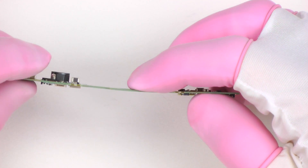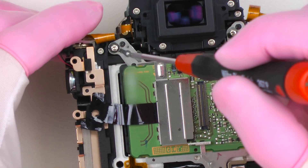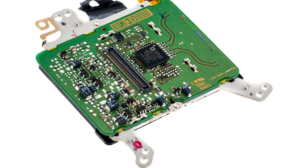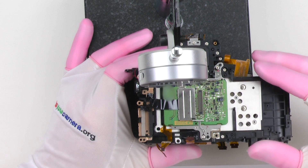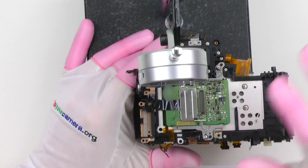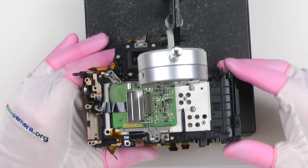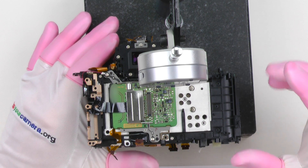Bottom board — also very thin and flexible, not too many parts on it especially in the middle. In many DSLRs these days, including this one, CMOS sensors are adjustable by screws. There are springs under these three Torx screws, so by turning them you are changing the distance between the sensor and the surface of the lens mount. It's super important to measure the position of the sensor before removing it or before touching these screws — it has to be a very precise measurement. If you don't do it, it's almost impossible to put it back together and have it focusing properly without Canon tools and software. There are some hacks to calculate the correct position, but really it's a big pain.